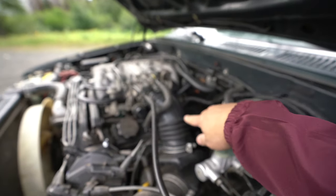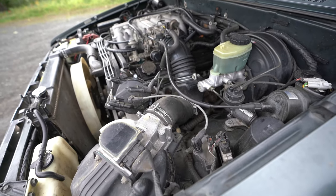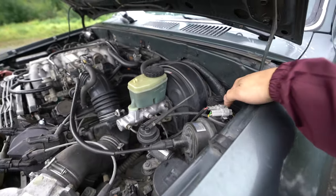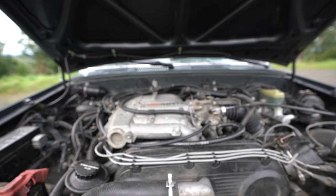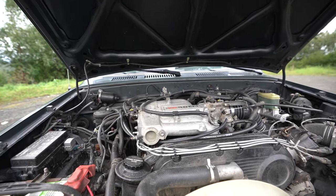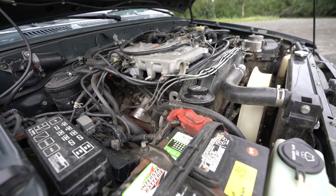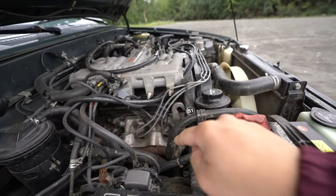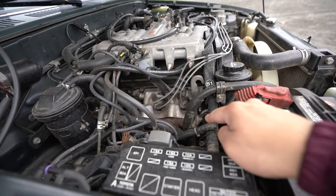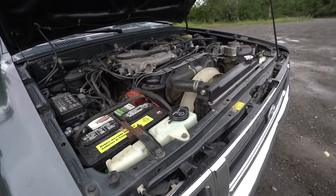This boot here was starting to get worn out so I ordered one on Amazon and replaced it. I also replaced the clutch slave cylinder. I removed the intake and cleaned it out. When I removed that intake I also redid the valve cover gaskets, so I don't have any oil leak anymore. Also, one of the passenger header bolts was stripped so it wasn't holding the EGR cover plate — I replaced that header with a new one, so now it's completely sealed with all new exhaust gaskets.